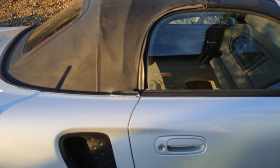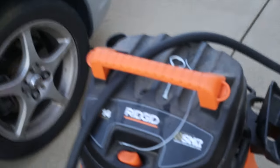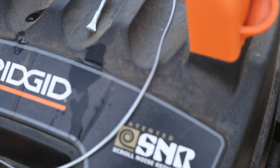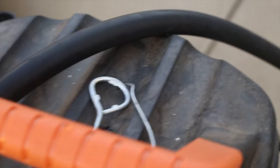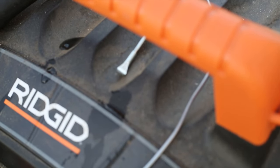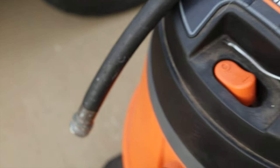The requirements for this job are actually fairly simple. What you'll need is a shop vac — this small one works quite well. You'll also need a small metal piece bent into a hook to reach up into the soft top drain, and a small pry tool. In this case it's one used to open paint cans, but we're using it to pull off the side air vents. And finally, a garden hose — pretty self-explanatory.